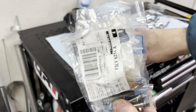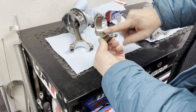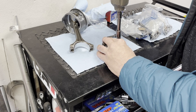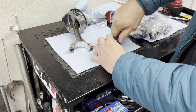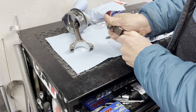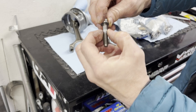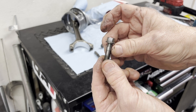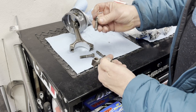I did take the bearing back out so I don't damage it during the bolt swap. The best way to get these out is to push down and then turn them out — there's a little sleeve on the end of the bolts that keeps them retained. On the new bolt you can see that sleeve holds the bolt in place as a friction fit, so you'll have to tap the new one in. Once it's tapped in it stays in there and doesn't fall out. Discard the old bolts — they are torque-to-yield and can only be used one time.